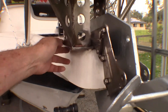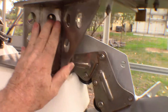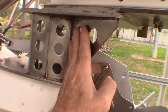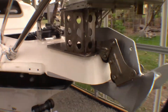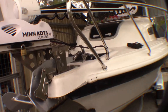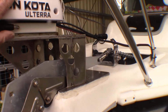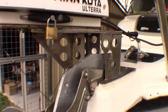Notice that when I did this, I left this part sit out over here so that I could get a lot of reinforcing on this structurally. On the modified plans, I took this gusset and took it out to the corner here. When I originally designed it, that was going to be the corner — now this is the corner in the new plans, I've made that bigger and taken it all the way out. That's about all I wanted to say about it. It's not that hard to adapt to suit any similar boat — you're just going to have to give it a little bit of thought. Have a look at my video, see the mistakes I made and try and avoid making them. If you can, mock one up out of wood or ply so you can sit everything up there and see how it's going to work before you actually make this. Then you might be able to avoid what I had to do in modifying it.